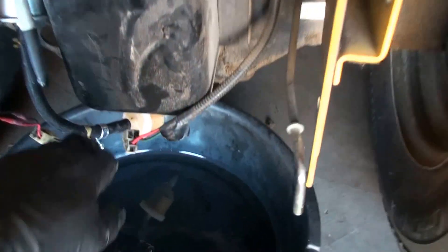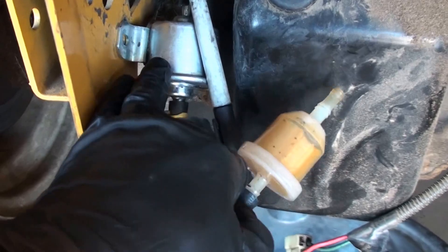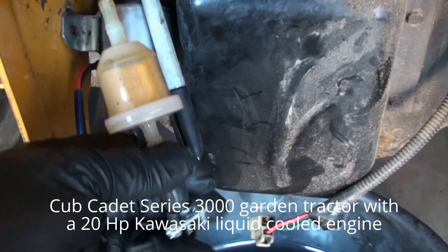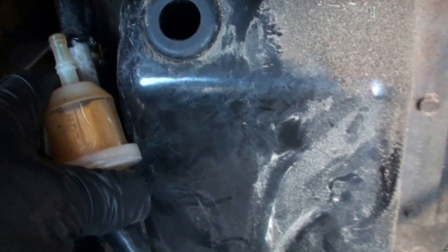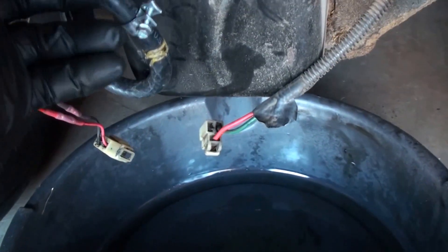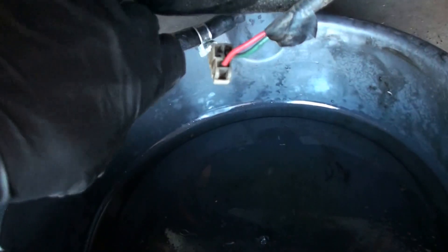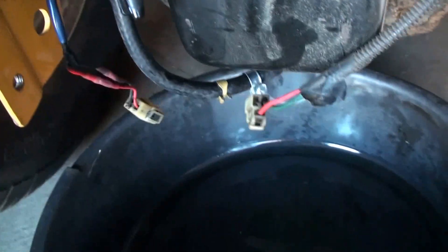Back at the tractor — here's the fuel pump. This is the 20-horsepower Kawasaki; I have a video on installing this electric fuel pump, link in the description. Here's the filter which ties into the supply hose up here. I just see drip, drip, drip down here. I thought maybe the hose connection was a little loose, since this line is a bit spongy, so I put another clamp on and tightened it down real good — still dripping.